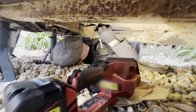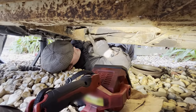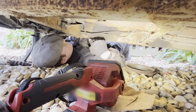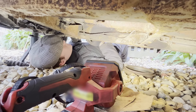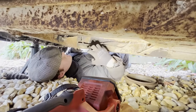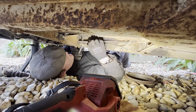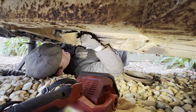I'm just cracking off this line out of the master cylinder. It's got a sort of two-way bit on the back - one comes out there, one comes out here. And then we've got two nuts to take off and then try and get the bolts out. We've got to try and prise the torsion bar out of the way and hopefully we can withdraw the bolts and then get the master cylinder out from above. We're taking this one off first so it doesn't get in the way and we can pull it up.